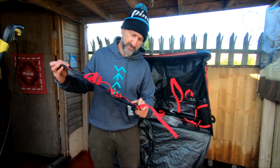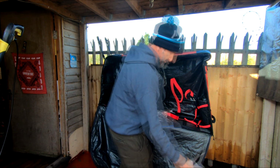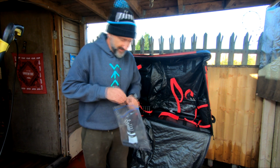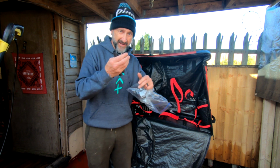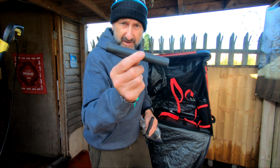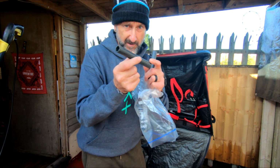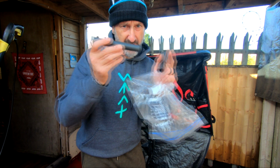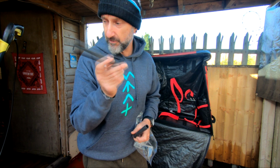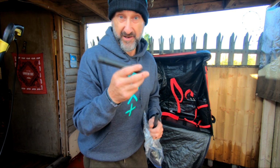Right, so we've got lots of straps, some kind of plastic frame pad here, frame pad, top tube. Okay, I'm guessing that's protection. Oh, my mate basically made, and this is another good idea, I'll take the axles off and then put these through the insides of the axles to replicate your wheel, and then it'll tighten, and it means that your frame can't squash together, so they'll hold your forks and your back end together really.